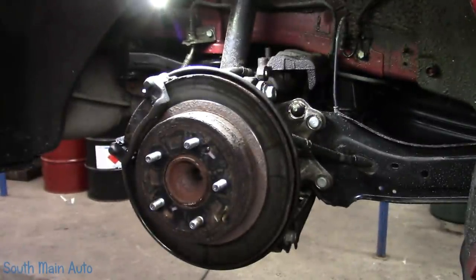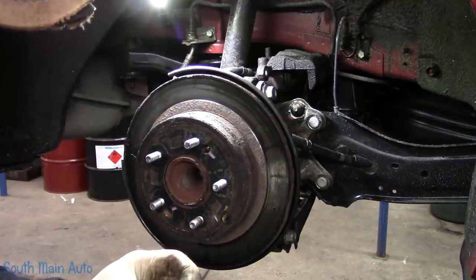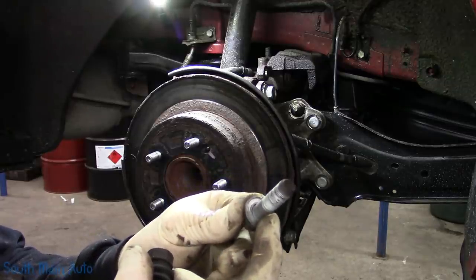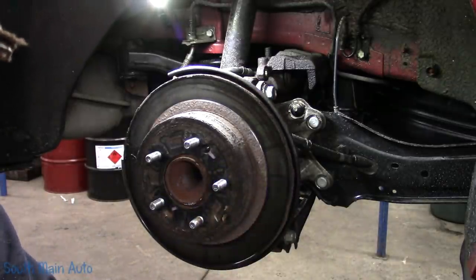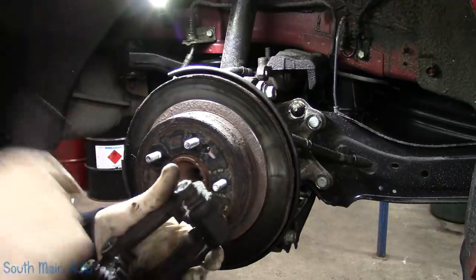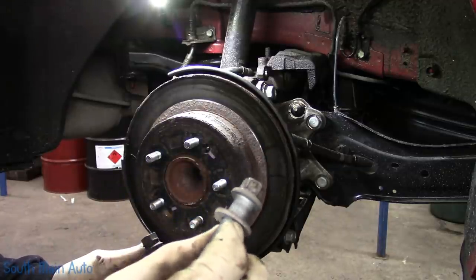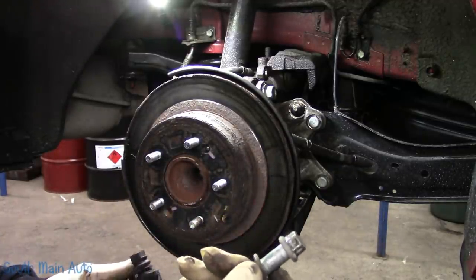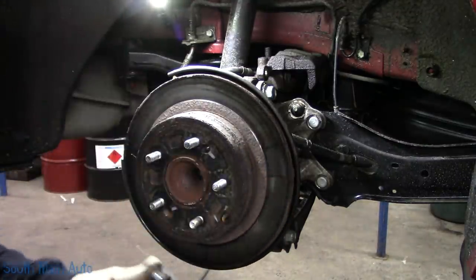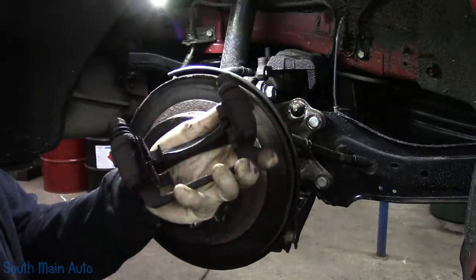Maybe that's where the 2.8 comes in. The bolt's coming right out — I thought they'd have Loctite on them, but they don't. It must be they're starting to seize on the straight shank portion of the bolt on these foreign cars — that's typically where you see the problem. What'll happen sometimes is if they're crusty enough — now this is a 2015 so it's not too rotted out yet — but say it was like a 2013: the head will snap right off these little rust-rodded shanks. We've got our bracket off here.